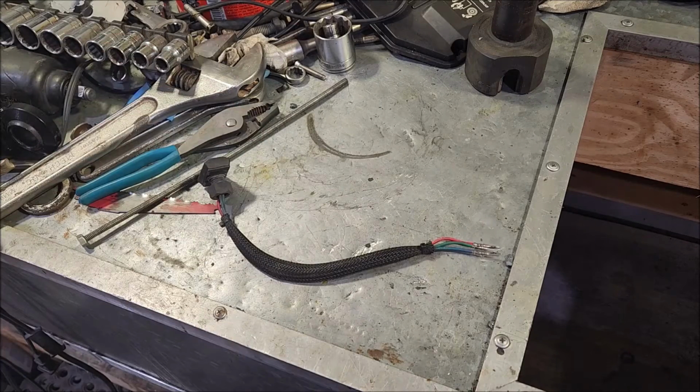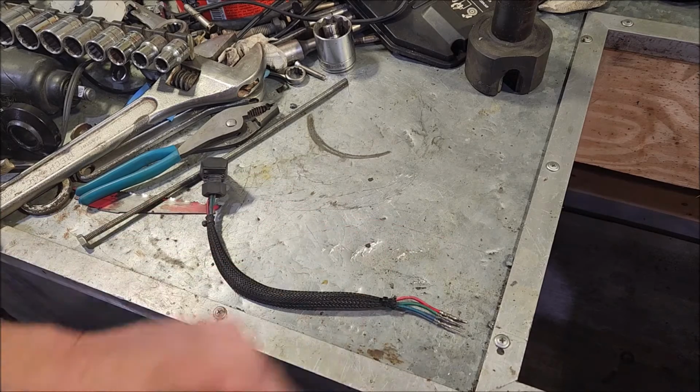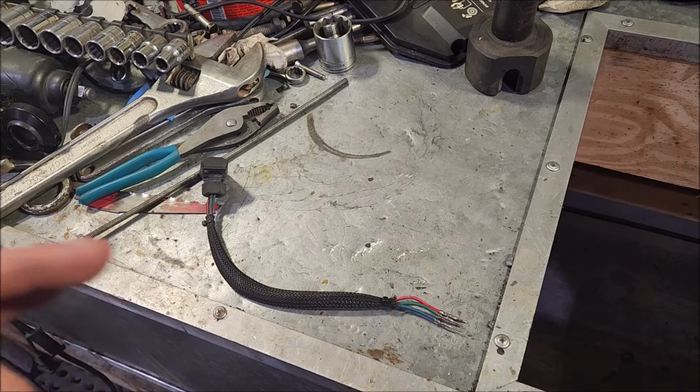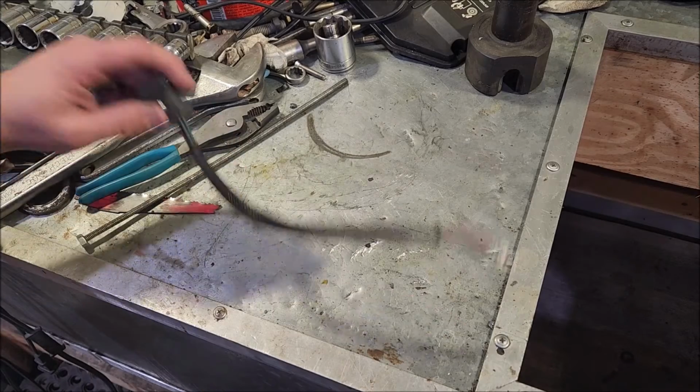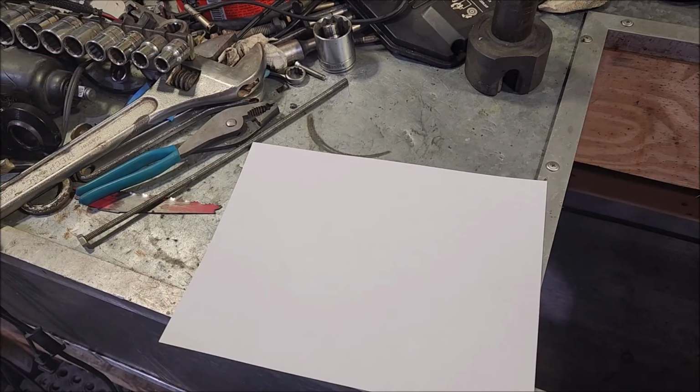So yeah, that is the basics of how you're going to do it. I would tap into the controller, add your 3 wires to the front of the boat, add a switch. That is the basics of what you're trying to do. Now let's get a little more into the engineering. You don't need to use a factory switch. You may want to find an aftermarket switch or not an Evinrude switch and use one of their bezels to make everything look halfway decent.